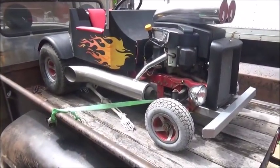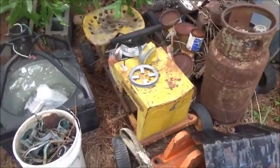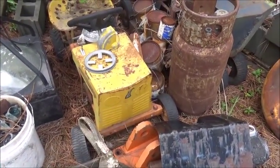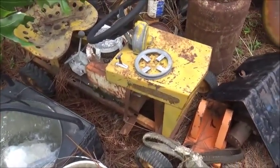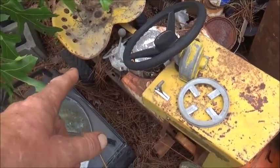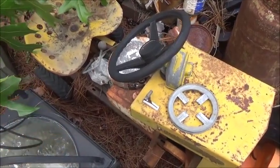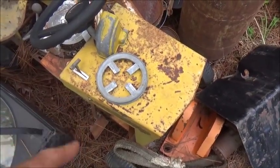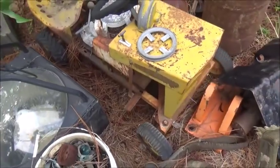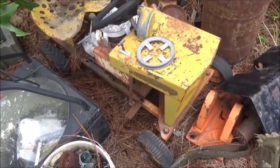Everybody's seen the go-kart I built for my grandson — it's in the back of the old International. We actually took it somewhere. Okay, here is a Mustang mower. I've actually got the deck for it — got everything for it. It's probably about a 26-inch mower. This was the seven horse and they always put the sticker on the front showing the horsepower. This thing is tiny. Somebody sat a bag of fertilizer or something on the seat and it got down on the transmission and engine — it actually ate a hole in the engine. We cleaned it up and JB welded it, but it ate the bottom mounts of the transmission, thinned that out, and the pulley broke. So I need a transmission part. We've had the engine running on it, but when my grandson gets to the right age and is interested in this stuff it would sort of motivate me to help him out.